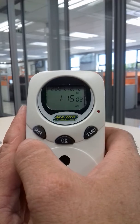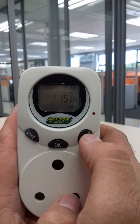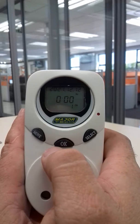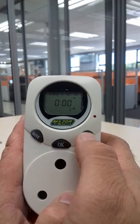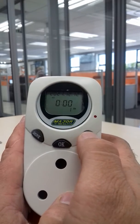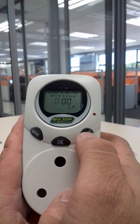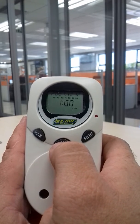Press the move button to see 'off'. Now to set the timer programs, push select twice — select, select. Press ok. It says zero there — you see it. Press ok, the week is flashing. Now we select Monday to Sunday.